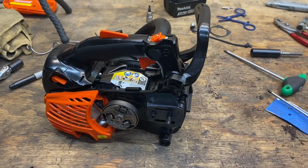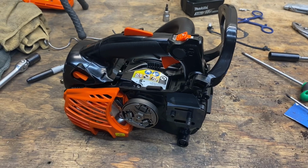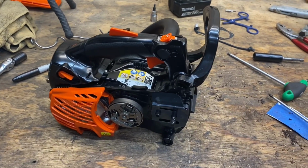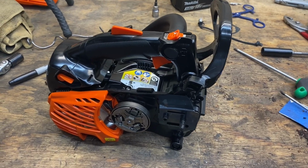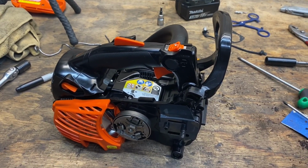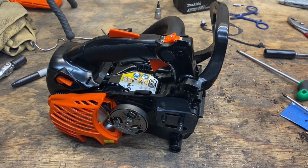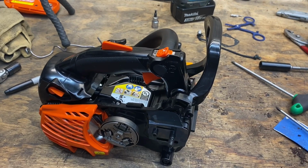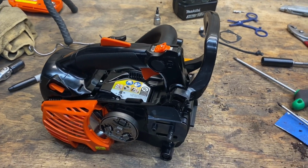So I finally got around to doing a cylinder only port job. I had a guy send me in two brand new 2511 T's, so I took the opportunity to try doing a future kind of deal where I want to do a cylinder only port and send it out to guys. So there was no machine work done on this cylinder. It's basically a Woods port, but I did change the timing on the cylinder.